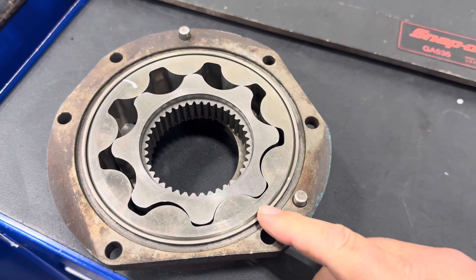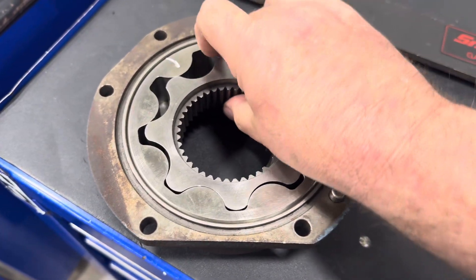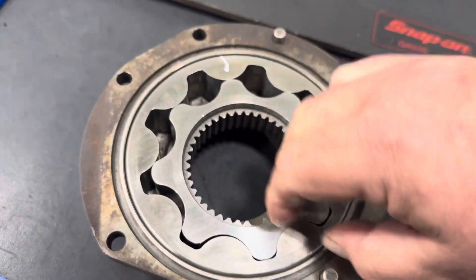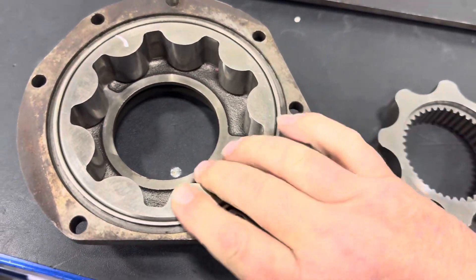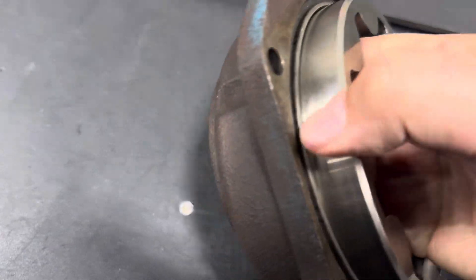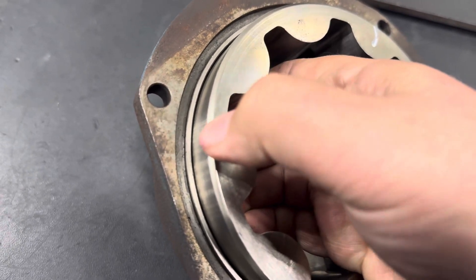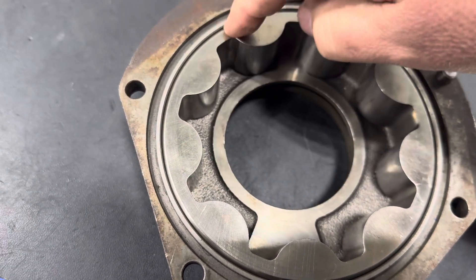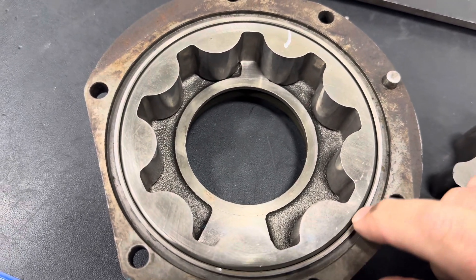Another test: if we take this gear out, it makes it easier to lift this gear up. You can see that this gear slides into this housing right here. What we also measure is the space between the housing and the inner or outer gear, because if that clearance is excessive it would cause a leak and a loss of oil pressure.